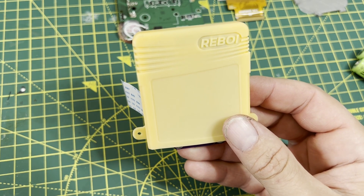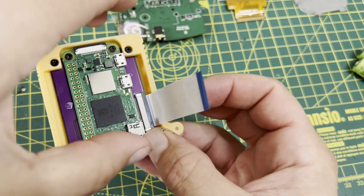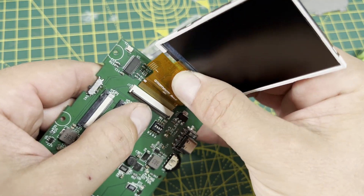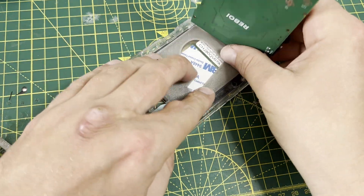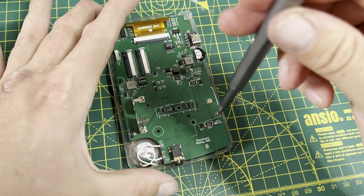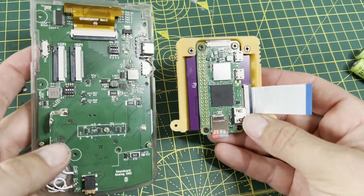This whole thing just sits in the back case and it's held in place with those little tabs you can see at the bottom when you finally button up the enclosure right at the very end. With that done, we can go ahead and start work on the front half of the shell — this holds the motherboard and the display. The display and the motherboard just plug together, then this little bracket fits around the display to hold it in place inside the shell. It simply presses in from the top, and that's the motherboard installed. You just go ahead and use three screws — the same screws in the same position as you'd use for securing an original Game Boy Color motherboard to the case.